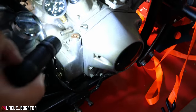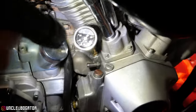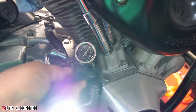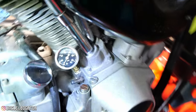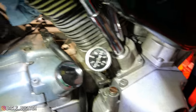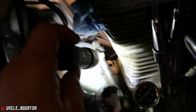Alright, a little bit of an update. I'm actually now more lost than I was earlier when I put the camera down. I've been on the phone with Shelby back and forth most of the day. There's a barb right there that was supposed to be the cam chest breather and on a whim I decided to take the hose off — this is supposed to be a reinforced hose and it's not. I started getting oil flow out of it by taking that off, so I put the pressure gauge back on there and I was getting about 16 psi.